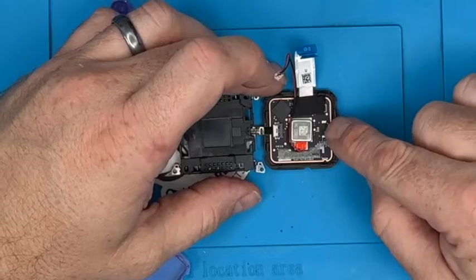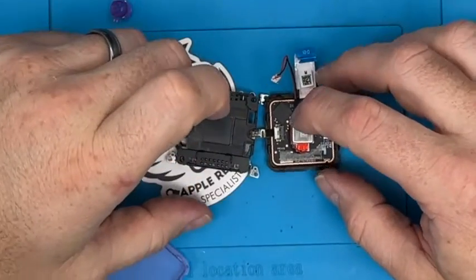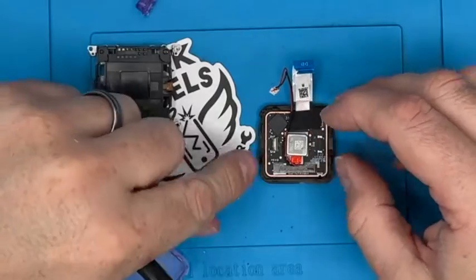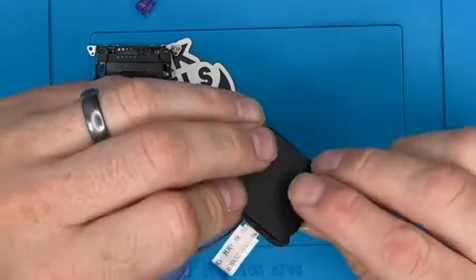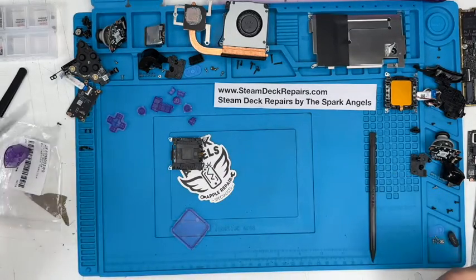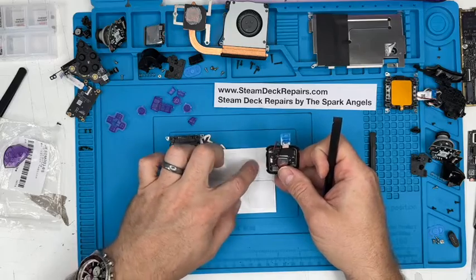What we have to do now is put that on a heat pad and lift this section out without damaging it. And there isn't much room around the edge to put it, and we don't want to be damaging any cables. So we'll lift this clasp just for old time's sake. We'll pull that out and we'll heat that up on the heat mat face down, just to warm, because that whole patch is an adhesive layer. I've got screen adhesive stuck to my elbow. Now in my previous shell changes, I've kept the adhesive if it's been absolutely 100%, which it has been. If not, you can use these.